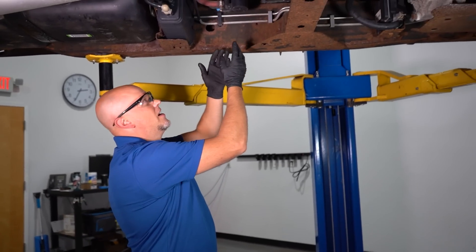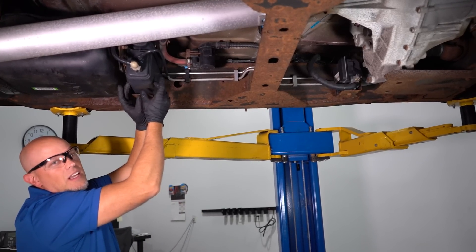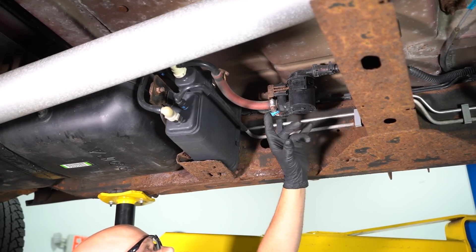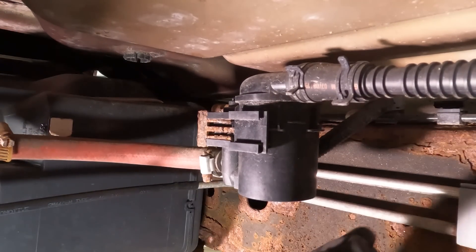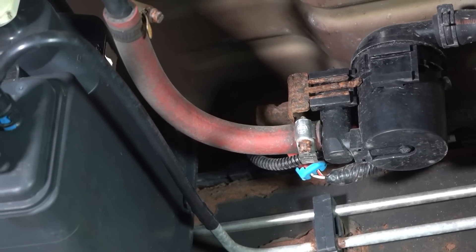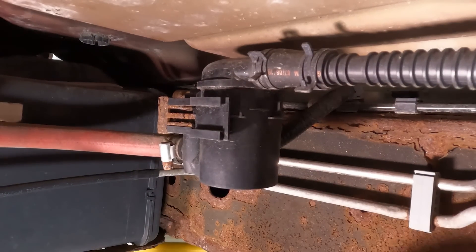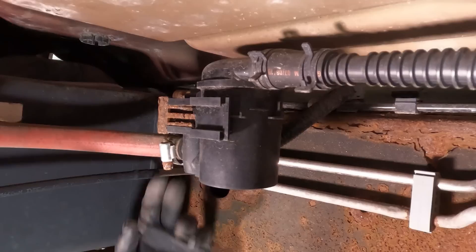Now underneath the vehicle, let's talk about the vent valve, which is located right here on this vehicle. It's going to be somewhere near the fuel tank or especially near the vapor canister. This is where there's a charcoal canister and the vapors go through the canister and get trapped. The vent valve's job is completely opposite of the purge valve. When there's too much vacuum on the system, the vent valve is going to open up and allow less vacuum in the system — it's going to allow fresh air in. This valve is very simple: it opens and closes with two wires to activate it. The only difference is this valve is normally open, and when power goes to it, it actually closes. So let's take it out and take a look at it.